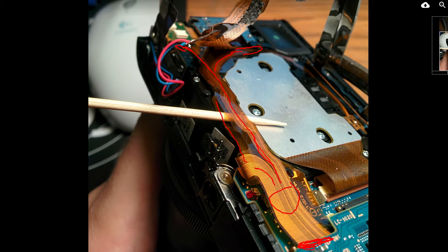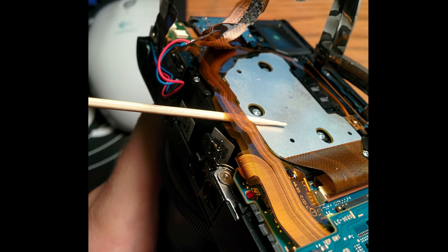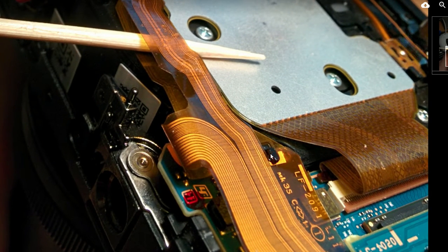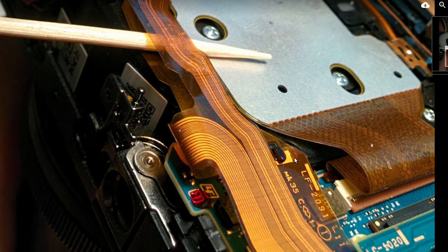So either you're going to have to find the plug over here where this one's going and unplug it from there, and unplug it from here. You see this little clip right here on that cable? You need to unlatch that. Don't pull up on that cable with that little clip on there — it'll rip that cable. You see this little plastic hinge? You've got to push this cable this way and get that around, get this part around it, and unlatched. Then that'll get loose.